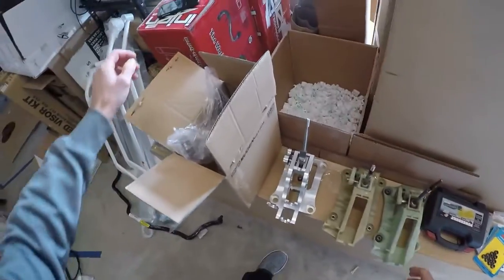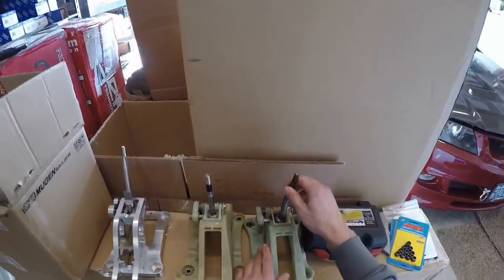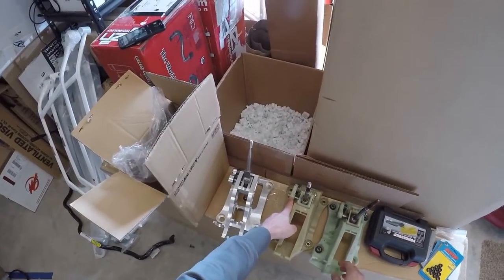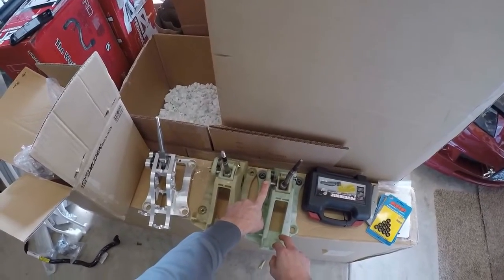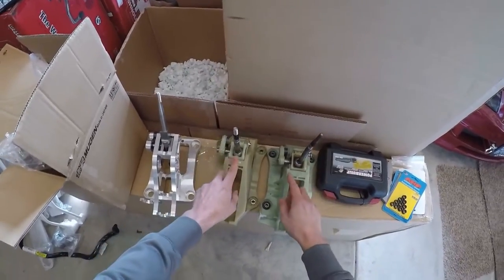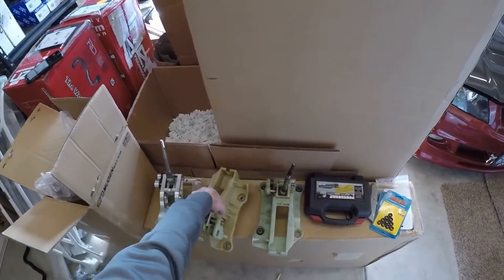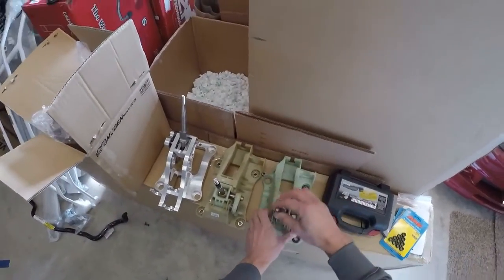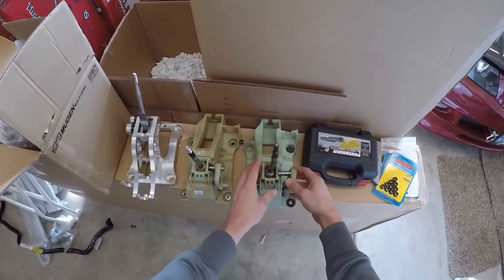Right away you can see the difference. You have a complete new assembly with a new lever and a new bushing. Like I said in the past, this bushing can get a little bit of wear in it, and that has a really detrimental effect on how the side-to-side feels. The shifter is also straight up and down versus this one that has a little dog leg in it. This actually goes in the car like this, so it has the effect of putting the shifter a little bit more in the center of the car rather than off to the side.